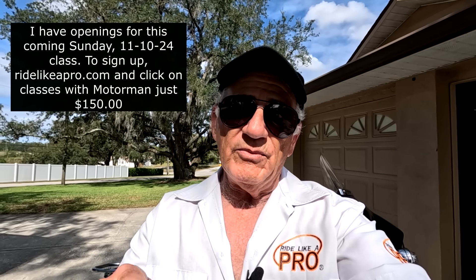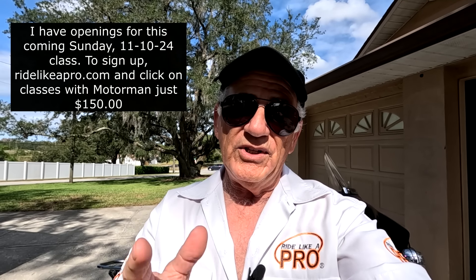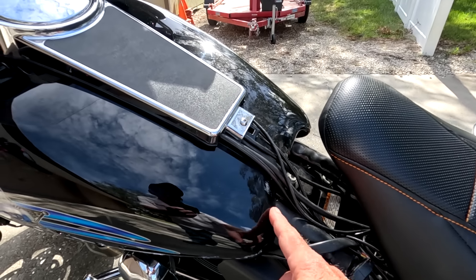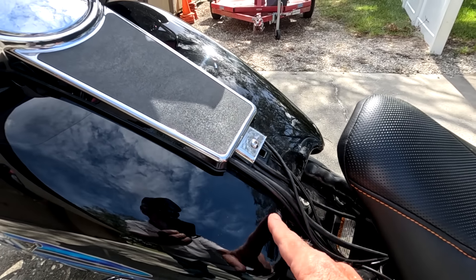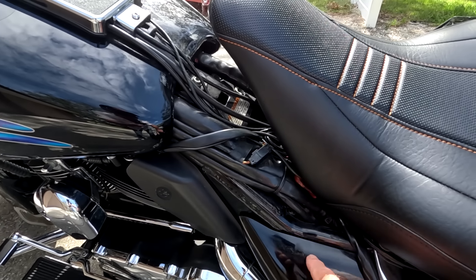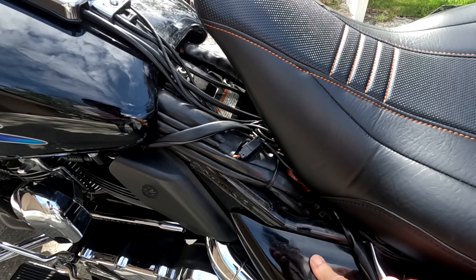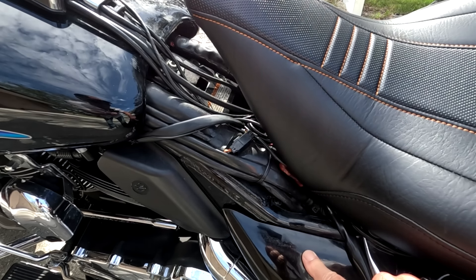At the end of this video, I'm going to give you some detailed tips, because many of you — especially if you've got a Harley-Davidson — are going to have similar problems to what I've had on my older Harleys. This area right here is pretty much a problem on every Harley-Davidson. With the seat pushed out of the way, you can see it's not impossible to fix with a little wet sanding and buffing — it'll look like new. On these side panels it's the same thing: the seat rubs right here and just mars the finish. I think you can get that out — I did, and I'm going to show you exactly how.